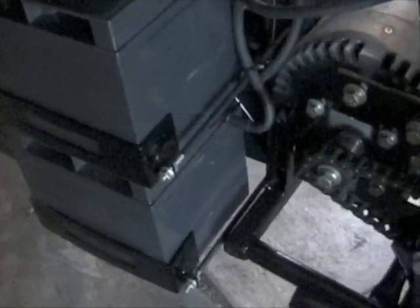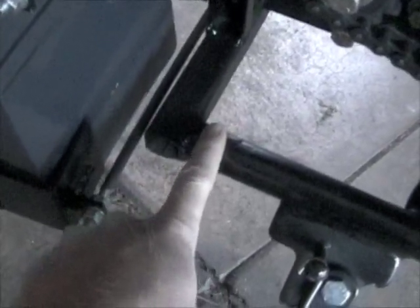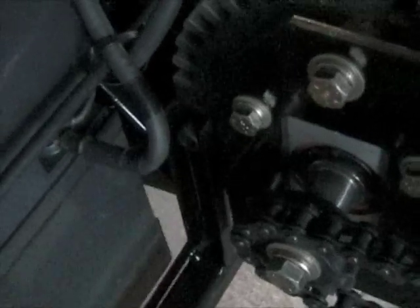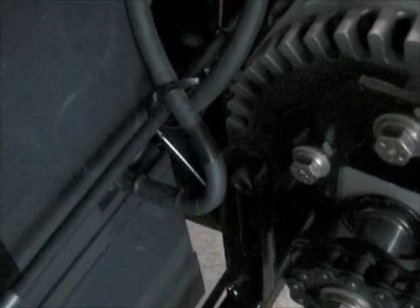I'll explain the battery setup a little bit. That required some frame modification — essentially I had to cut the frame back starting here, and this forward section is all new. This is a support for the motor, and this is the motor plate. There's also a support that goes back here, welded to an old part of the frame that was also cut, and I have some schematics of that on the website. It's hard to see here because the batteries are in the way.